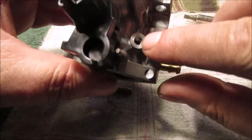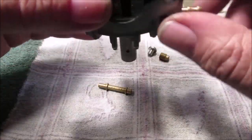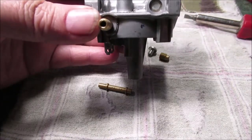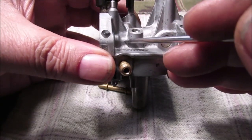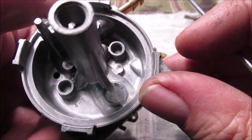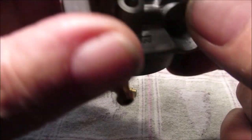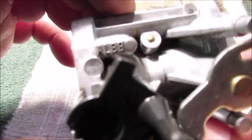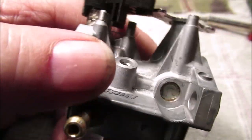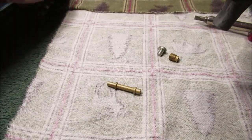There's a screw here that is your low-speed jet. Your air is going to suck in here — see that little path? Get my pointer — most carburetors are all similar. It's gonna suck air and just regulate how much it sucks. There's nothing underneath here — I can't tell if those are Welch plugs. Welch plugs are these little plugs the factory uses when they finish machining cross holes.